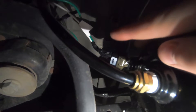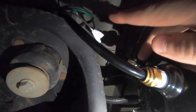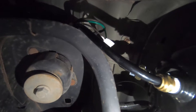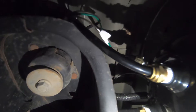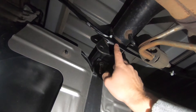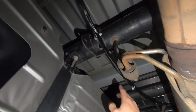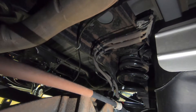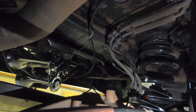The pressure switch has a couple wires — one is load and the other is power, tied into the main power line running up to the battery. I'll show a wiring diagram on screen. The air hose is all taped up and zip tied to the frame, kept as far from the exhaust as possible. It runs along the frame all the way back to the horns — just the air hose and the load wire to trigger the horn run back there.